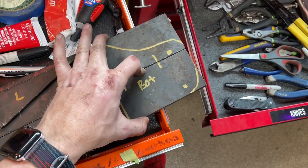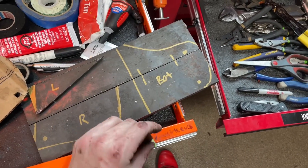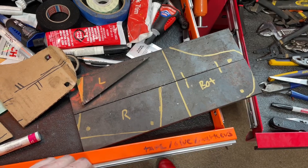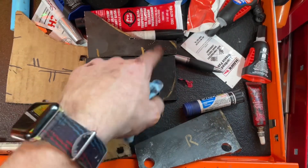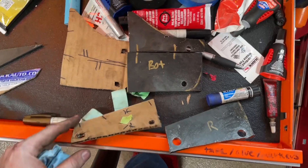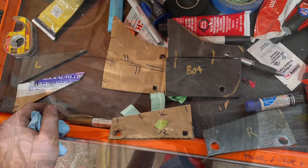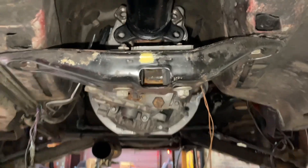This is 3/16" or quarter-inch steel — I used it for the M3 trailer hitch project, but it's the perfect size for the vertical plate. If I weld the two pieces together I should have enough for the rear piece too. My drill wasn't here but the drill press worked just fine — got all the holes hogged out. These are the big ones and they fit on the mounts. I'll stitch them together and that should make for a reasonably feasible mount. Ugly as always, but it's holding up on its own and I think that'll do just fine.